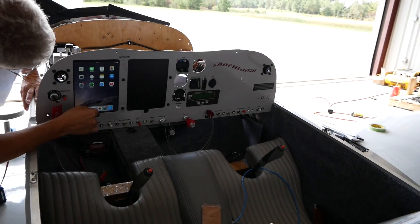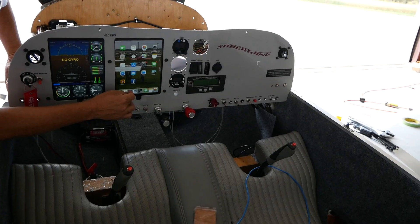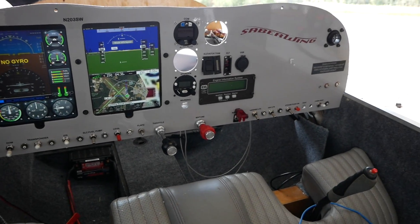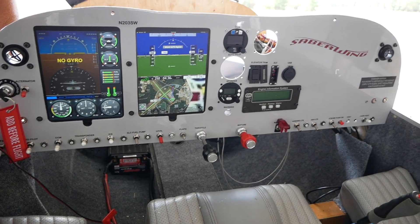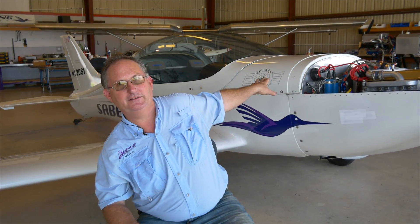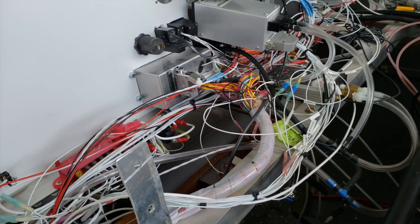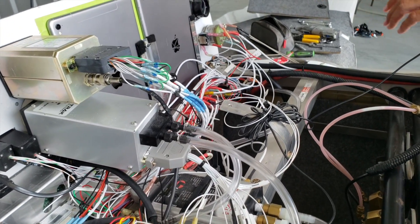One of the problems in building and maintaining aircraft is being able to maintain it and do changes. On a lot of aircraft, if you have to work on the avionics or electrical system, you have to be upside down — on your back, on the seats, working overhead. This airplane you can build the whole thing walking around it. It's built like a boat: it comes in, you put the landing gear on, and you walk around as you build into it. Down the road, if you want to do maintenance, the front cover behind the engine is always removable. The dash cover is also removable, so you can adjust your rudder pedals, change out the header tank, or do any kinds of upgrades or changes. If you sold the airplane and the new owner is four inches shorter than you, you can move the rudder pedals up for him.